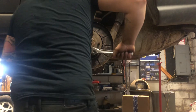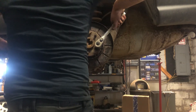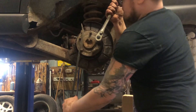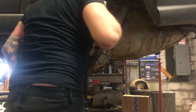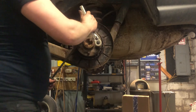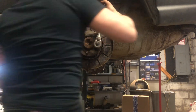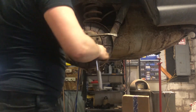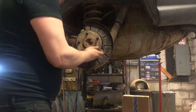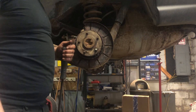Get on there. You should be able to put your fingernail in the back of it where the lip is and not get your fingernail in there — that's how you know you've got it all the way seated up against the hub. All right, now we're just going to take our lug starter off. Bam! That's how you replace a lug nut stud.